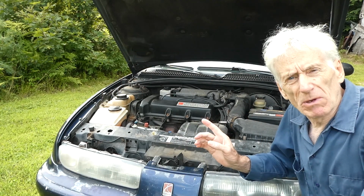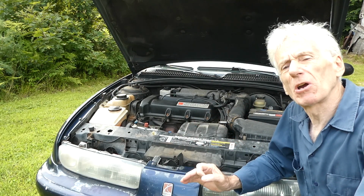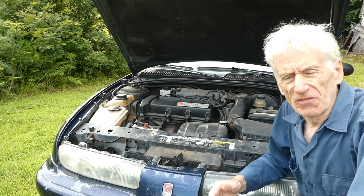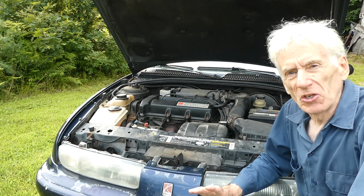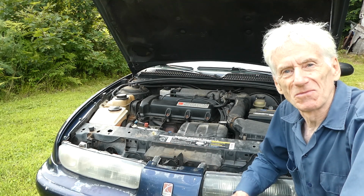We just got done replacing both high and low valve cores. So the next thing we're going to do is we're going to put our gauge set on and check the pressures. And if the pressures are low, we can add some refrigerant and bring it up where it should be. And I'm sure there will be no more problems, because that's where the leak was, the valve cores. So it should be all fixed.